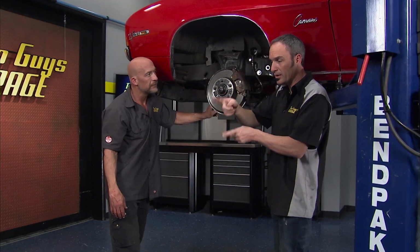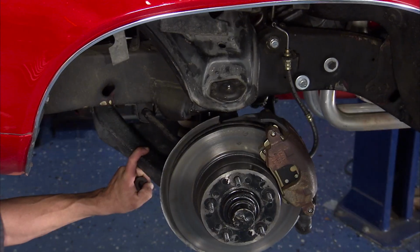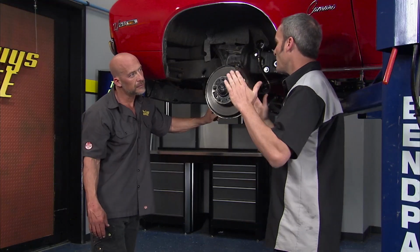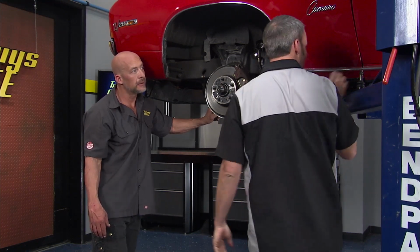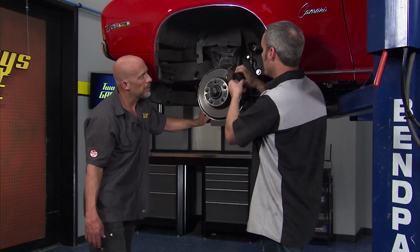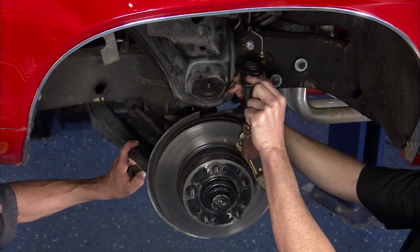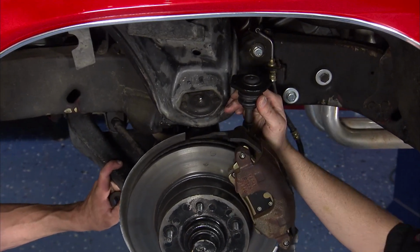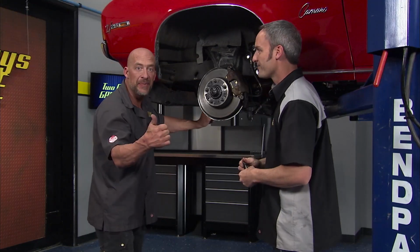So we've got a double A-arm suspension here, right? He was pointing to the lower, here's the upper. Now, with the original geometry, as you're rolling and body roll, your tire does a bad camber curve and lifts the flat off the bottom. So you're getting sort of camber gain, which you're trying to avoid when you're doing performance driving. By changing the ball joint, we're gonna make it new, fresh, and tight, but we're also gonna change the length on it. So it changes that geometry, gives you a better camber curve, more tire grip, lets you go faster. More contact patch always means better performance.